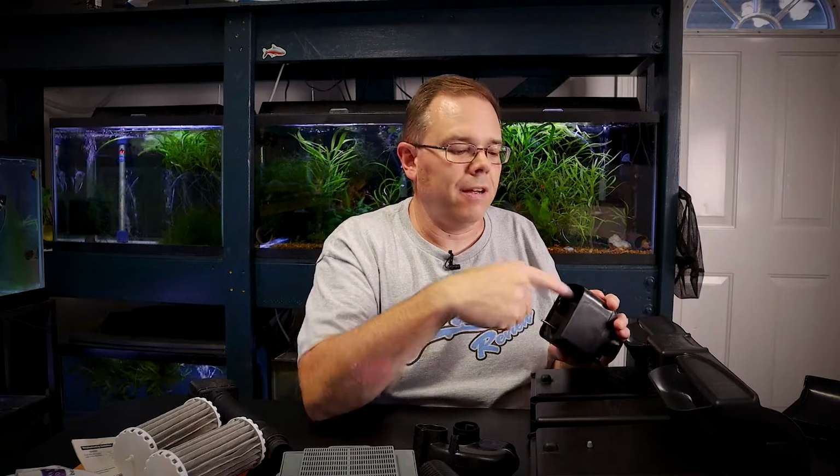So you'd always want to clean this magnet. I say it in all the videos, but maybe you haven't seen the others. Clean this magnet off, clean the fins, make sure there's not a bunch of moss or plants or rocks wrapped in here. And then if you can get a little brush in here, you probably don't have to in this one, and there's really not clearance. But if you had a tiny brush, you could brush it out in there. That would be good for it. And also, this area here, if you don't clean it very often, this could fill up with some junk. So just sweep it out.